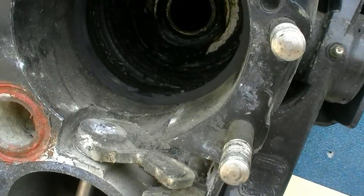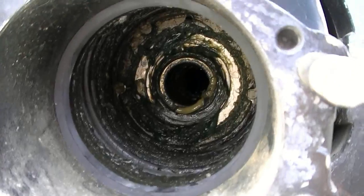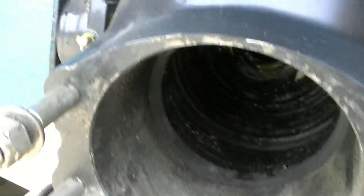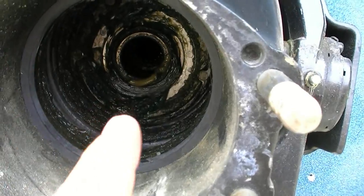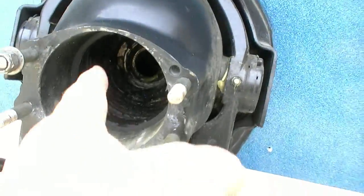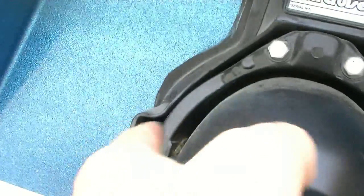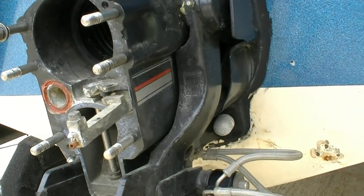And you want to check your gimbal. And we just replaced the gimbal bearing last year, so it's all good to go. Let me see if I can show you what I mean, see how that little green stuff kind of pooked out right there? Let's see if I can do this with one hand. Oh, no, it's not. This took actually six pumps to get that to come out on the gimbal bearing inside there. So you want to make sure you get them good and full, because the gimbal tends to shed that grease. So we've got all this done. You also can see how it's kind of pooked out right there, pooked out on the other side. So make sure you find all the little Zerk fittings and make sure they're good and greased.